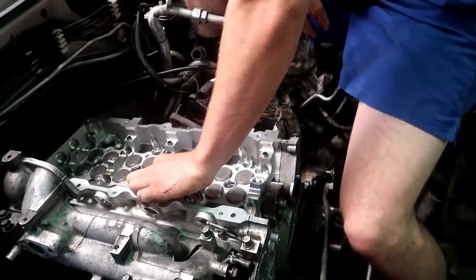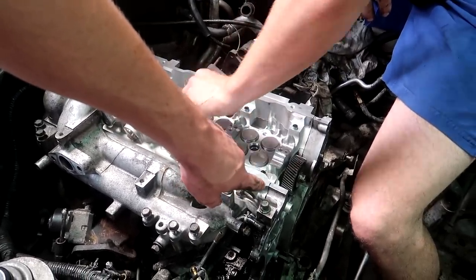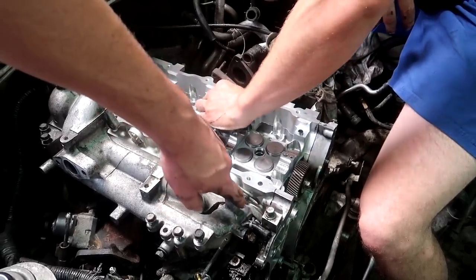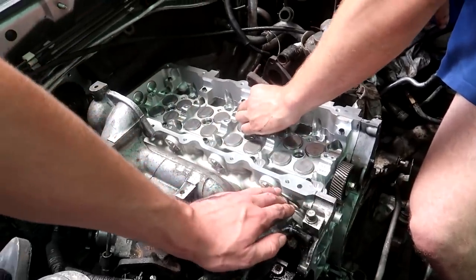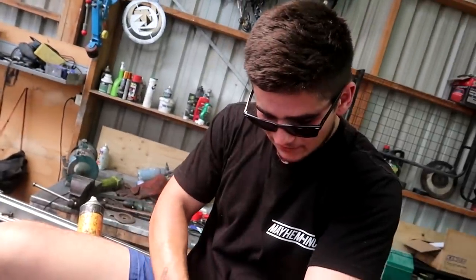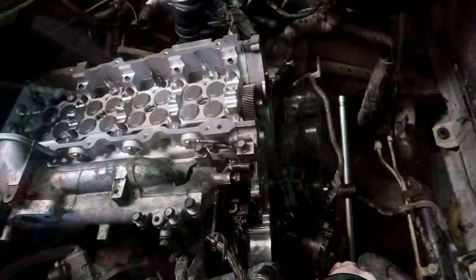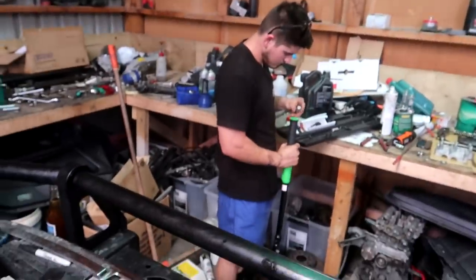Because this has silicone on it - this gasket to stop it leaking, it's very common for these front cover gaskets to leak, same on SRs and all Nissans that are timing chains. There's a bit of a trick to it - you're supposed to torque the head and this front cover in a sequence. Otherwise if you torque one and then torque the front cover after, it'll have leaks. Here's my arm - you Jeffers don't know about heat until you come to Gisborne - holy, like average 30 degrees and in the shed it's like 40 plus easy. New head bolts here - assuming these head bolts are torque-to-yield so replacing them.